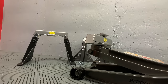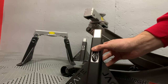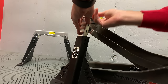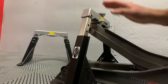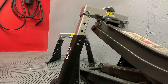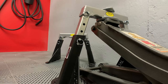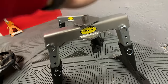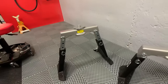Then you just lift it up — you start lifting the car up. You also get these pins and the side pieces. You lift one of the side pieces up into the top piece and push the pin all the way through, then do the same with the other side. This is a little easier when there's tension on the piece from the car. You'll notice there are different holes — you lower the jack until that hole is in place, then push the pin through. Do the same on the other side and then you can release the jack. To remove them it's the same thing in reverse: put the jack underneath, lift it up, pull the pins, and drop it down to the ground.